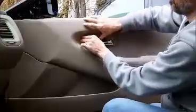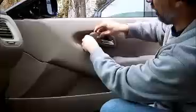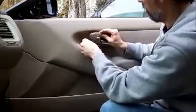Next thing we're going to do is pull the screw here, and pull the screw here. Start from the front — always start from the front. Pull that forward. Unplug, and make sure you push this in while you're trying to unplug it. This is the trickiest part of pulling this whole thing off — this little clip back here is a pain in the butt.